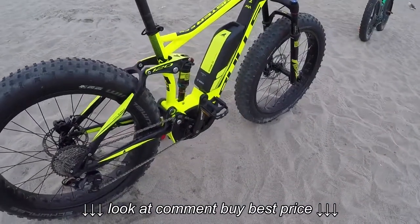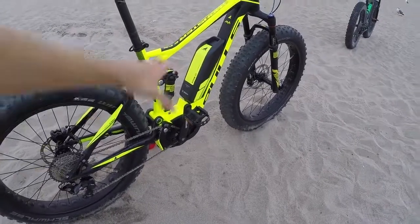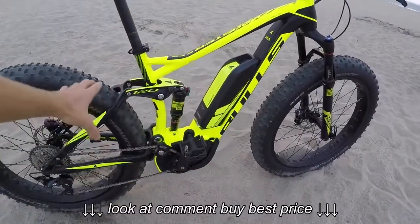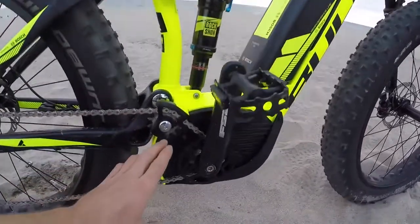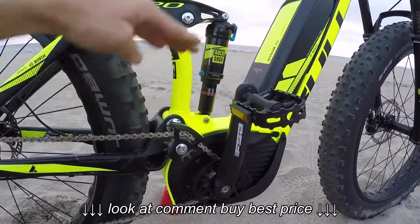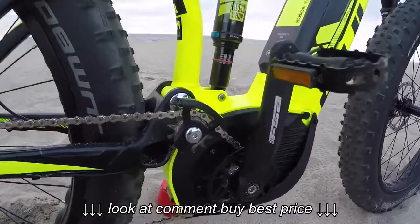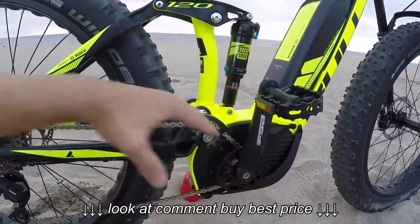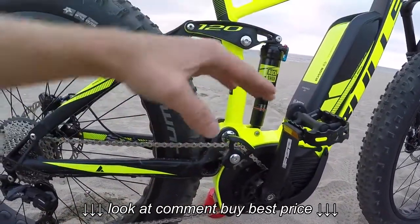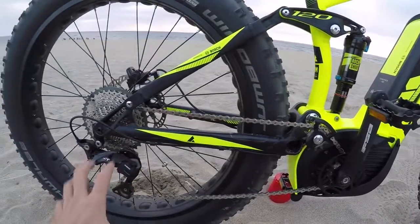Other things that I like about this bike is the geometry, the way they've laid it out. They've got that four-link suspension back here, and then they've raised the chain with a little tensioner. The tensioner has a bit of a cover on top, so it keeps the chain from bucking too much. And it's a narrow-wide pattern, so you're not going to get slipping - it grabs that chain really nicely regardless of what's happening with the suspension.